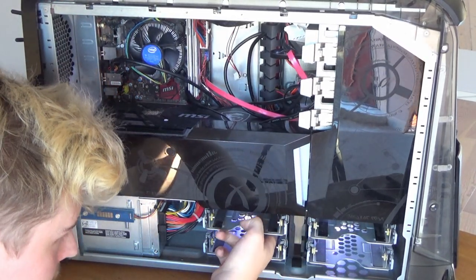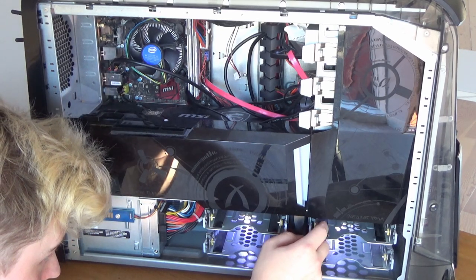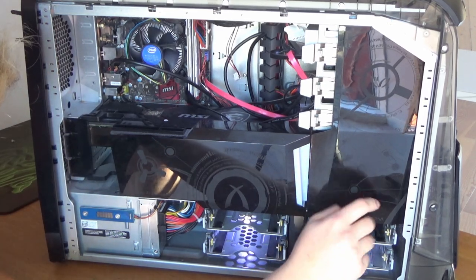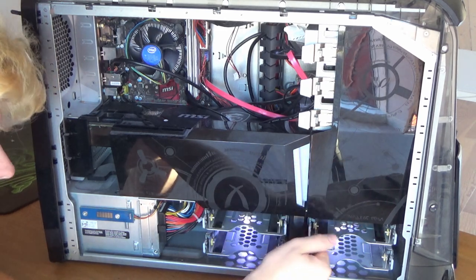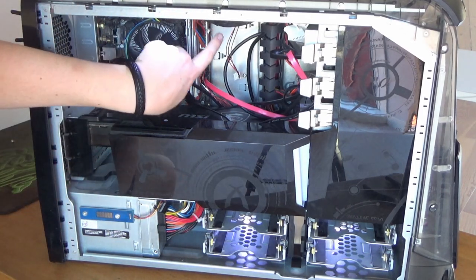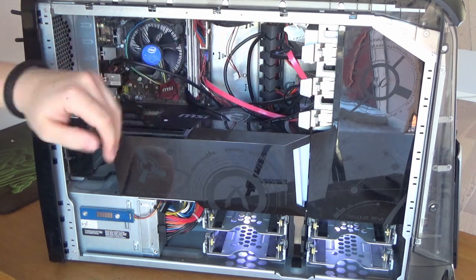And once you do pull it out, you will see that this is essentially a fan here to the MIO board, which is back here, master input output board, which connected back here. And this fan is supposed to cool the hard drives. And they have all these different fans. They have one small here, which is supposed to cool the RAM on the MATX version. Now I have an MITX board here, so that's why it's not covering it.